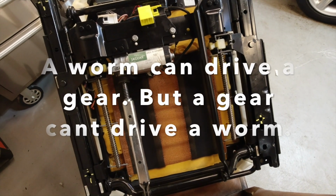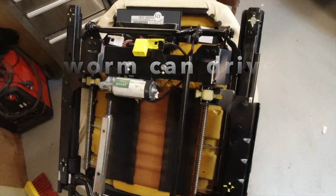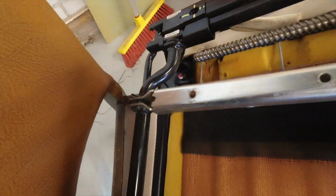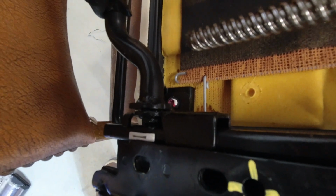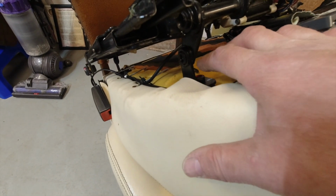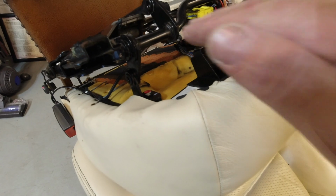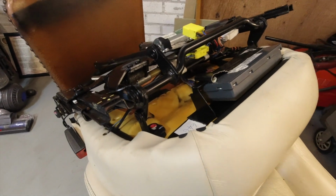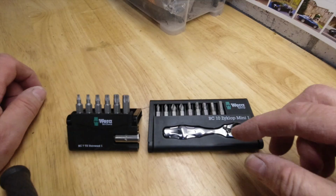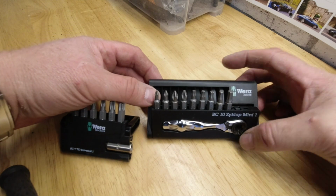So the only way of getting access to do further steps to remove your seat is using the screws which I've highlighted in pink. Those screws are literally just below the squab of the seat, and they are the contact point between the seat and the rest of the mechanism. You should be able to get access to them no matter where the mechanism is, forwards, backwards, up and down. But to do it you will need a very particular tool. This is a tool I've shown on my channel before, very useful on the odd occasion, but without it, I don't see how this job can be done.